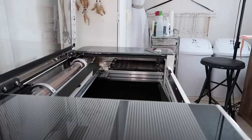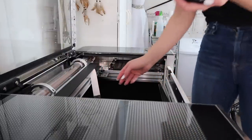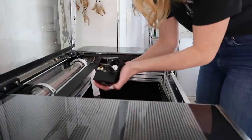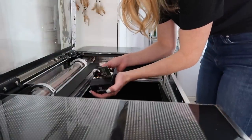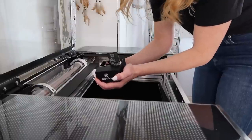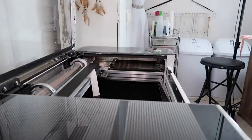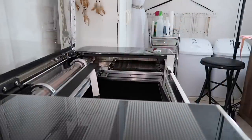Pick up the wire ribbon. Hold on, what does it say? Pick up the wire ribbon holding only the finished black surfaces of the printer head. Pick up the printer head and wire ribbon as shown. Slide the ribbon onto the head. Make sure that the tab on the wire ribbon is facing up. Slide the ribbon into the head until it clicks.